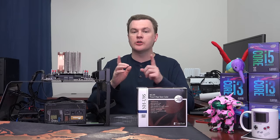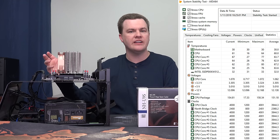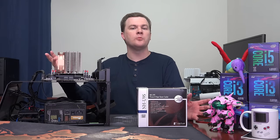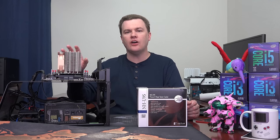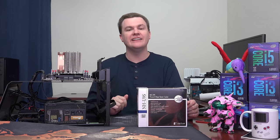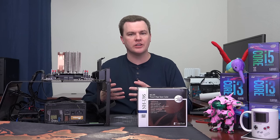I was very pleased with the cooling performance. I had no issues running an AIDA64 stress test on this 10-core CPU. If you wanted to run a Ryzen 7 1700 or 1700X, or an i7-8700K mildly overclocked — maybe 4.5 to 4.7GHz on all cores on Intel, or 4.0 to 4.1GHz on the Ryzen — yes, this will do that. The fin density of this cooler actually surprised me in person, and it makes more sense of its excellent cooling performance, because it's really surface area and airflow, not physical total size, that determines how well a cooler runs.